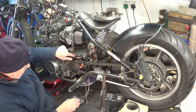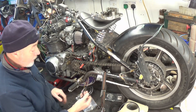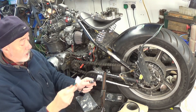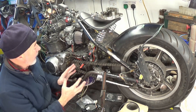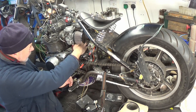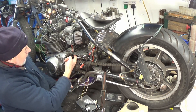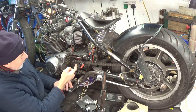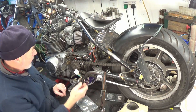In here I've also got a new switch for the gear indicator, because the speedo indicates what gear you're in. I've got the neutral and six different gear positions. That's going to go along here — I'm trying to hide the wiring as much as possible. I've got the ignition running through where the starter motor is, because there was a little access hole. I've drilled a half-inch hole in the back here to get the ignition wire out and also the starter motor wire, so all wires will be behind this case.